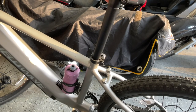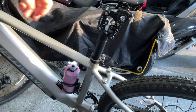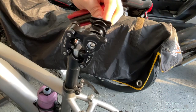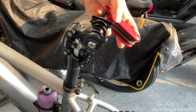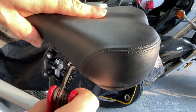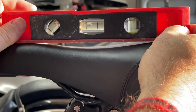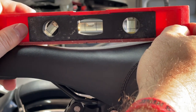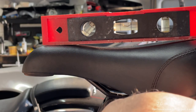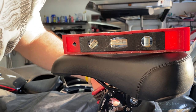Installing the post into the bicycle just to hold it in place and mount the seat. There are two clamps with a hex key on each side that I loosen just enough to snap the seat in on the rails — it still allows forward/back adjustment and pitch. I use a level to get it level, then tighten it down once the forward/back direction is set. This is torqued to between 15 and 18 Newton meters.